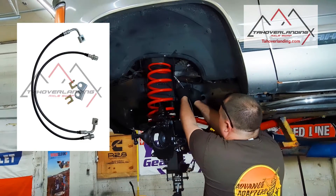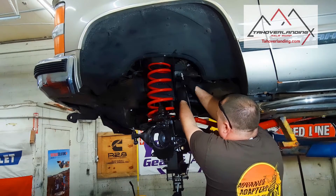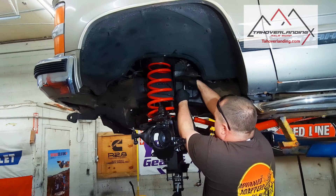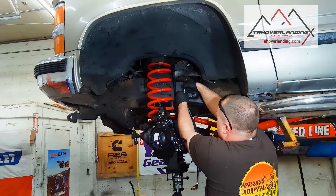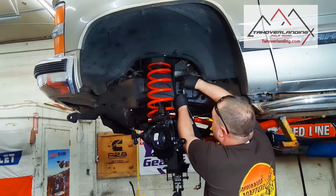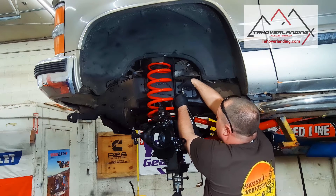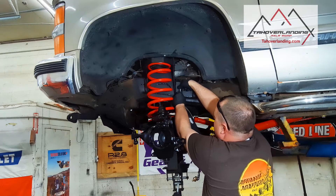I always keep a little plug on the end of the brake line while it's sitting here so we don't get brake fluid constantly flowing — it'll just keep flowing otherwise. Make sure to route the brake line through the bracket before connecting it.